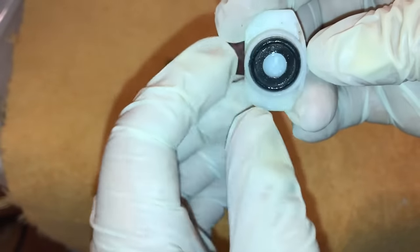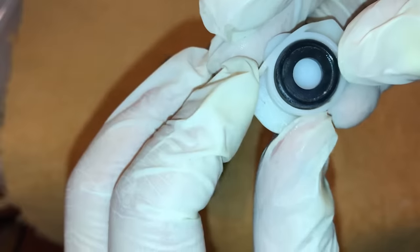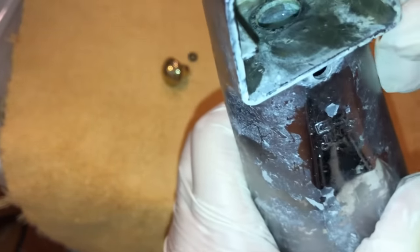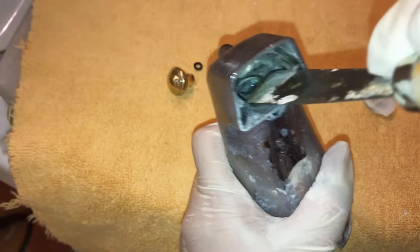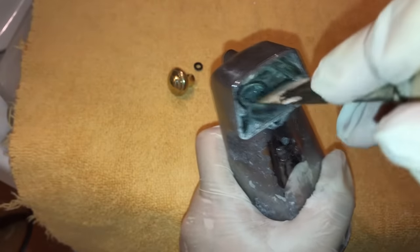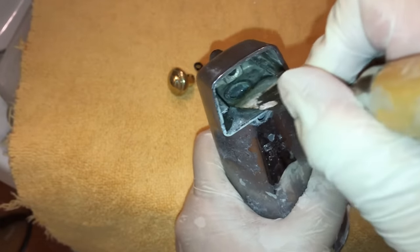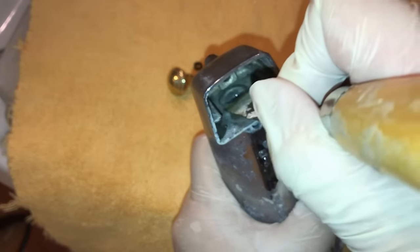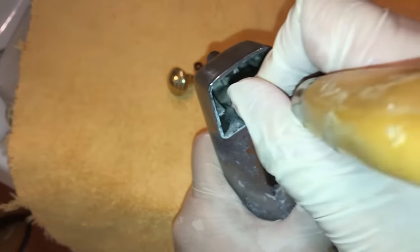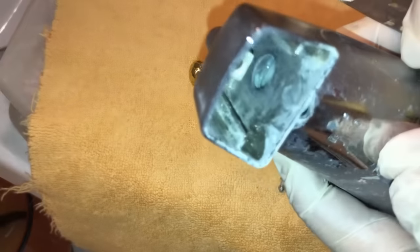Here is the rubber gasket and I can see that the gasket is worn out and I will need to replace it. But first, I see that there's some hard water buildup around the opening. So I'm using a narrow putty knife to scrape off the rough gunk so that the area around the opening will be nice and smooth. I think this looks good.